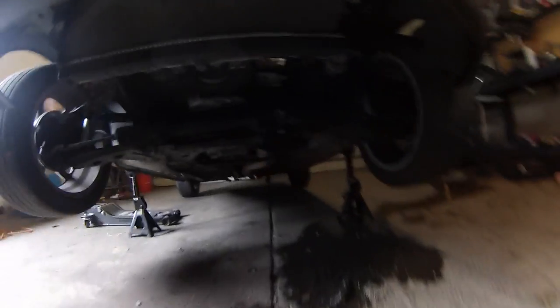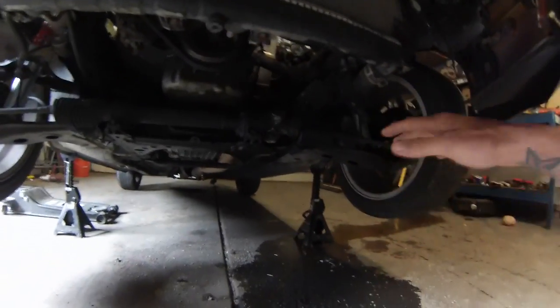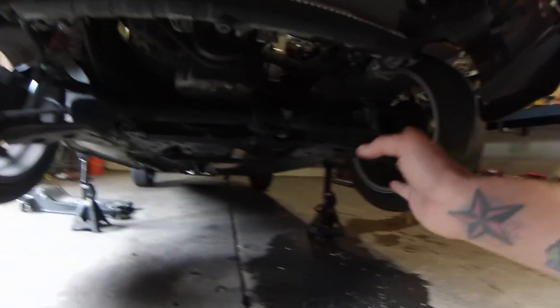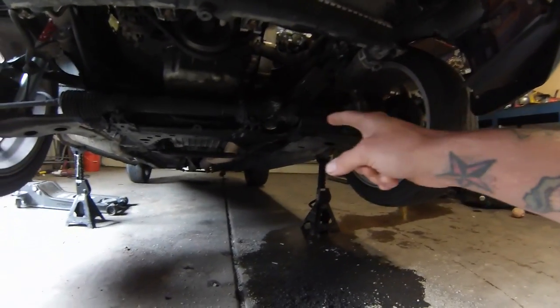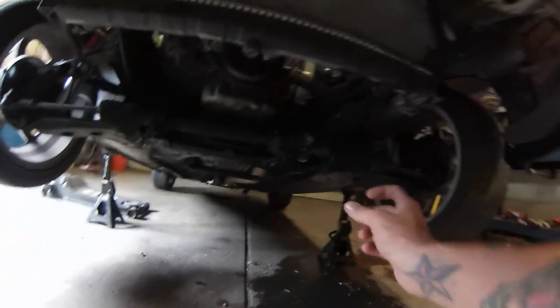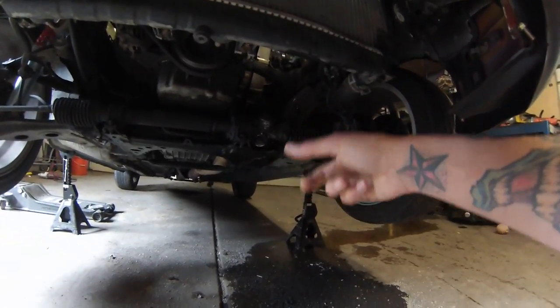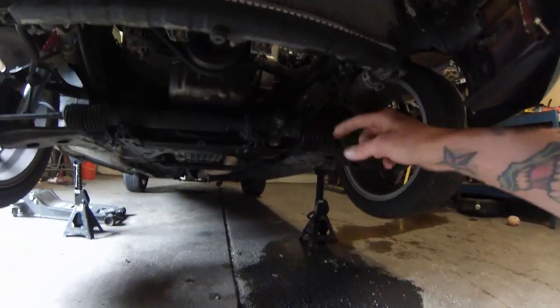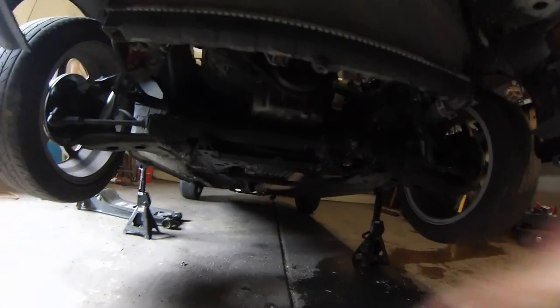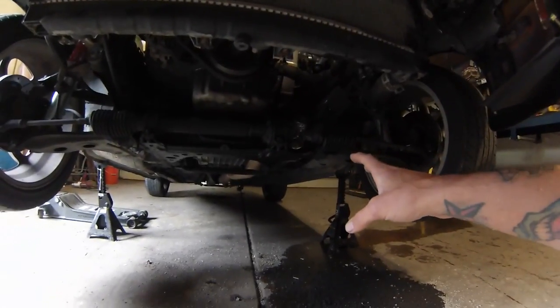The main factor is to not mess with the tie rod outers because that's what's going to change your alignment. The inners actually have a ball joint that spins freely so that when the car is moving up and down and the tires are turning left and right it allows them to spin freely. The inners are not adjustable so they don't affect your alignment at all, but they are held on with these tabbed washers. We're going to need to get the boots out of the way, move those tab washers out of the way, and then break the inners loose so we can unscrew them and drop them. That'll allow us to take the steering rack out completely.